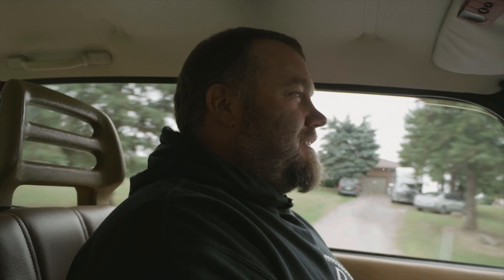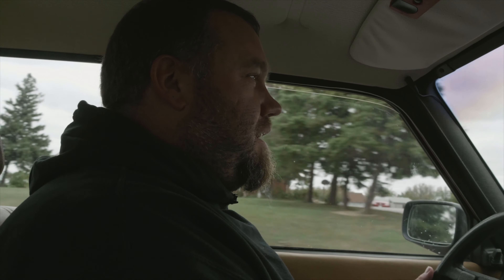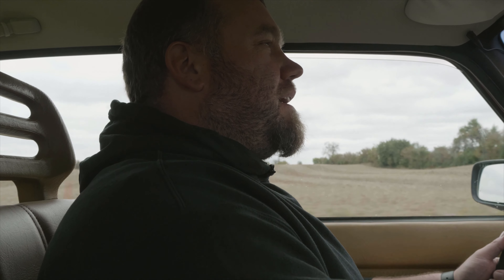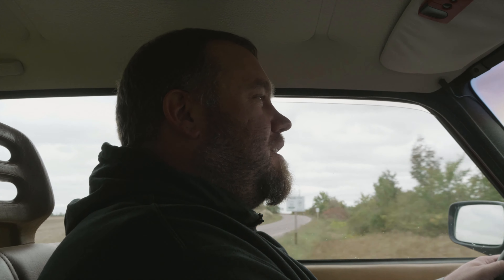It's good until you're going too fast. It needs suspension now — it just lumbers along too much. Just kind of gently rolling into the throttle. I don't want to trounce on it. The suspension's a little too soft and the car wallows and kind of does this weird wheelie thing. Something I need to sort out with the owner is some better suspension. Right now it's just got cut springs to make it stance-y, but the engine has overcome the factory spring — it's probably a bit heavier now, and with the added power, the torsional twist is not the best.